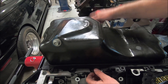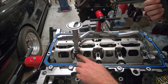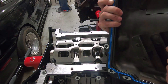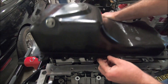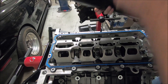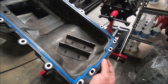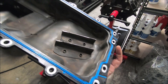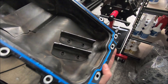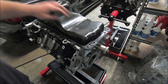We got quite a bit here — it's not even going all the way down. Yeah, that squished it flat, so we're going to have to take some out of this hex. We've got to take our pickup tube back off. While I have the tube out, I want to make sure the fins clear, so I'm going to put the pan and the gasket on there — and it's definitely not clearing. So we're going to have to cut those out. You can see I cut about half of the flaps off. Hopefully that's enough. Remember when you're cutting on these things — if you're grinding on it, do it away from your engine, make sure you have eye pro on, and then file any burrs off. You don't want any hanging pieces of metal getting into your engine. And that clears no problem.